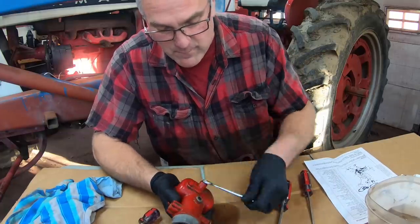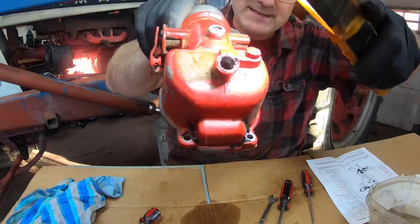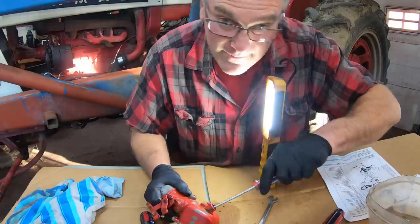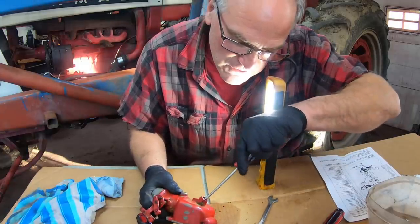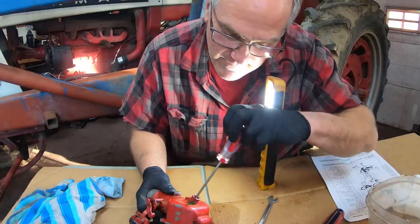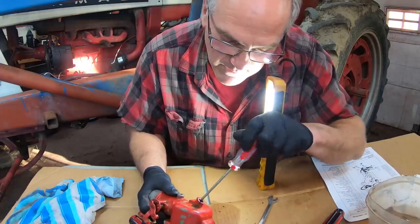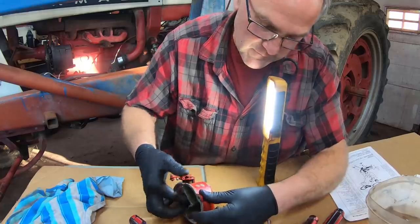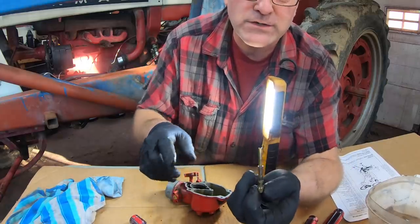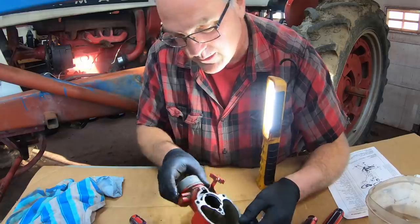My basic rule is if it can come out, I take it out for these cleanings, because there are so many little passages that you want to make sure get opened up so that when you soak it, all the varnish gets cleaned out. First I'm going to take this plug off the bottom, which I believe accesses the main jet. The main jet screw head is down in that hole and I can take it out through there. The nightmare in rebuilding carburetors is always whether you're going to strip out these little brass fittings when you try to take them out — you can wind up having to drill them out. This one seems to be coming out all right. There's the jet, which is one of the means by which fuel sprays into the airstream up through the middle of the carburetor, through the venturi, and into the engine.